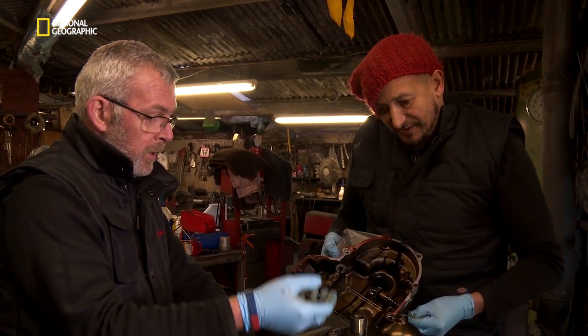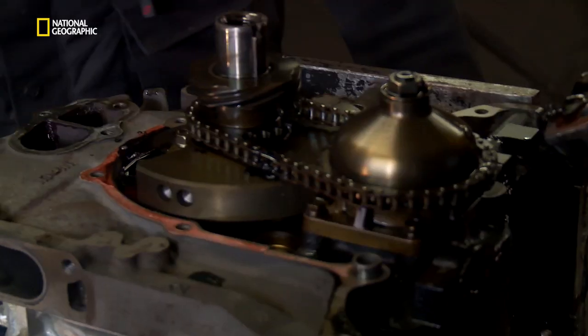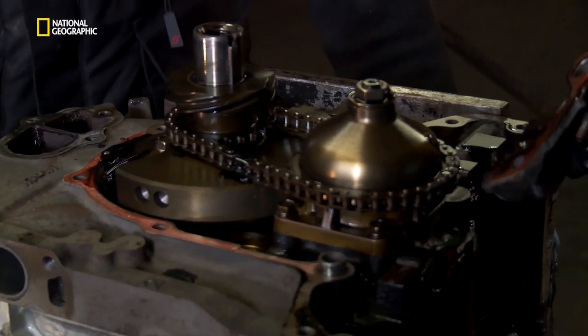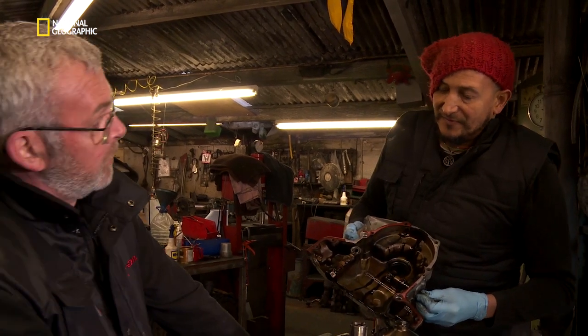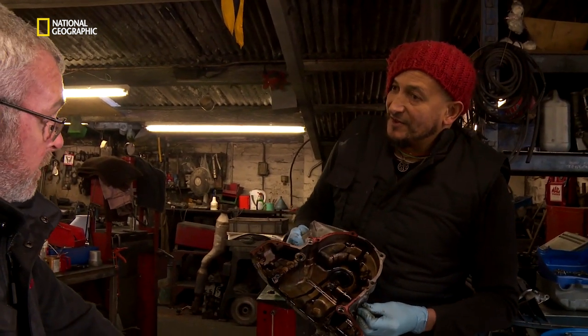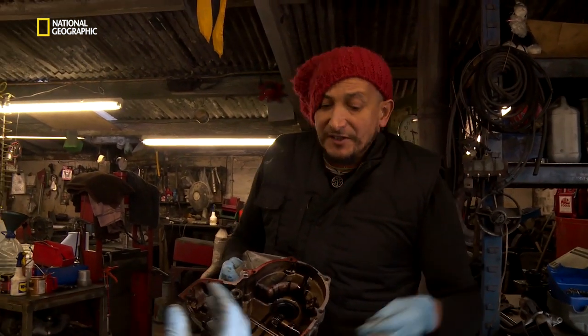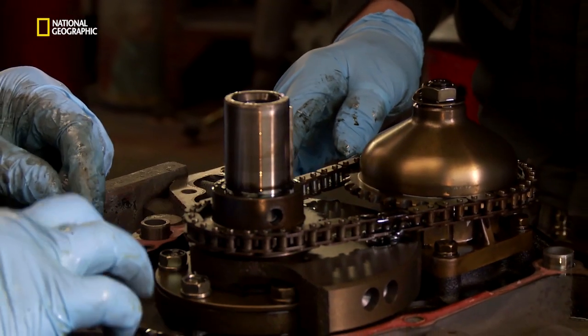This is the top of the shaft, and that chain is literally just driving the oil pump. So this is the oil pump for the engine itself. The oil metering pump puts the injection through to the small oil injections going into the housings — it's like a misting in there. It's a little stepper motor kicking the oil injection in and out, so it needs oil inside the chambers as well for slight lubrication.